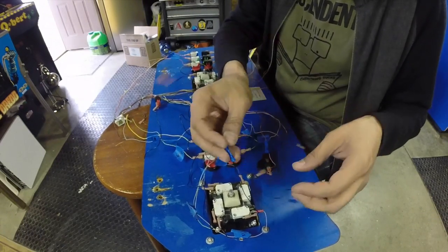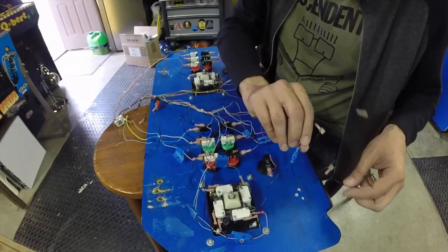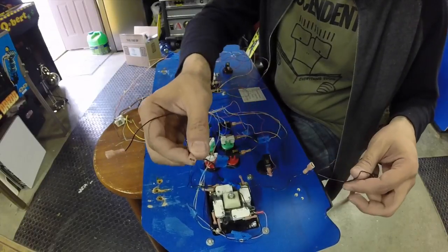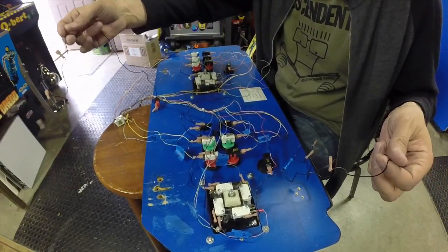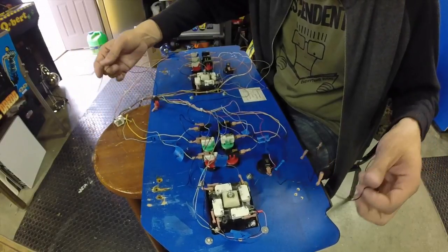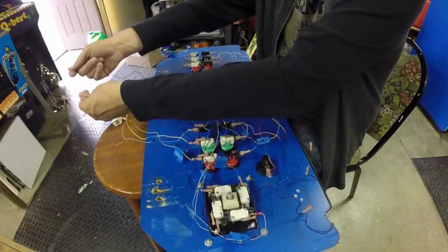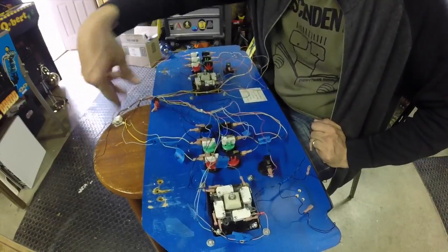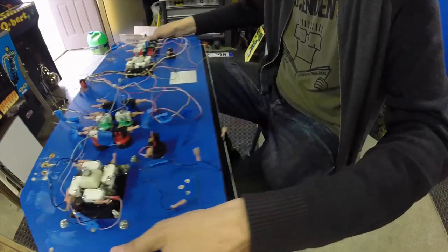Yeah, see, they did this weird junction thing right here, where they used this crimp to kind of pound everything together, but I might just undo that whole thing and re-crimp it so it is just one line running the entire circuit here. I really don't like the way that works. And then there's these two more here, three here, that are also all grounds. We do want to tie all that stuff back in. The grounds, like I said, are common, so I am going to do that. I'm going to go ahead and cut this and then re-crimp it. It should just take a minute.